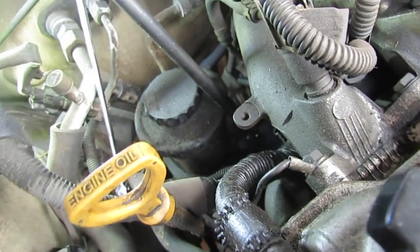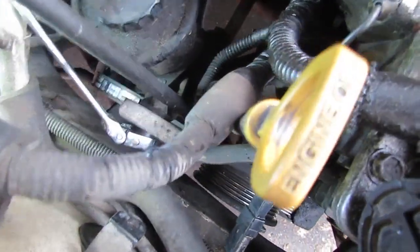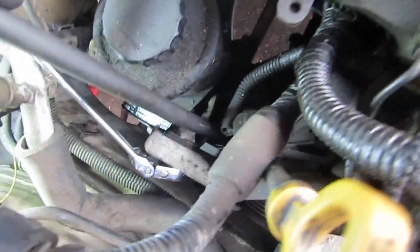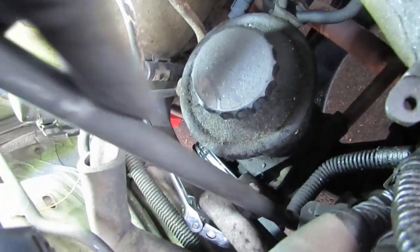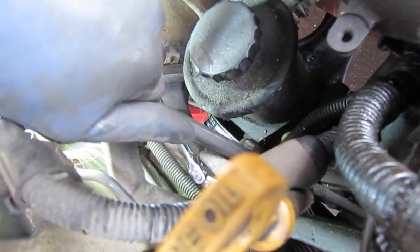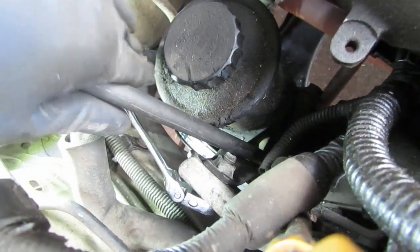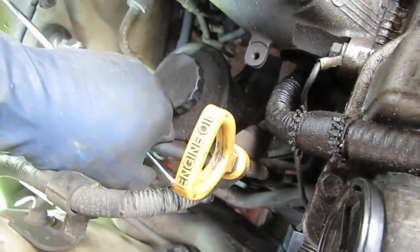And this is a 15 inch. So what I'm gonna do, I'm gonna slide it in right here. Like that. And I'm gonna push down against the back of the bolt right there. Like this. So I'm gonna go like here, okay? And as I push down against it like that, I'm gonna tighten it up with that at the same time, okay? So that's how you wanna get the tension on the belt.